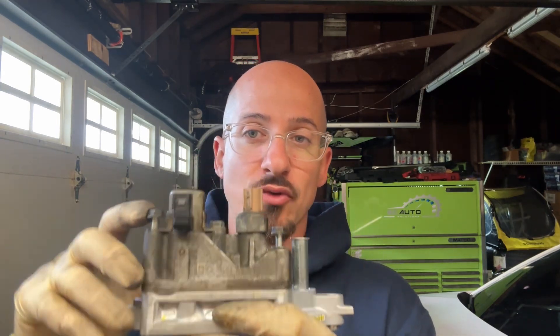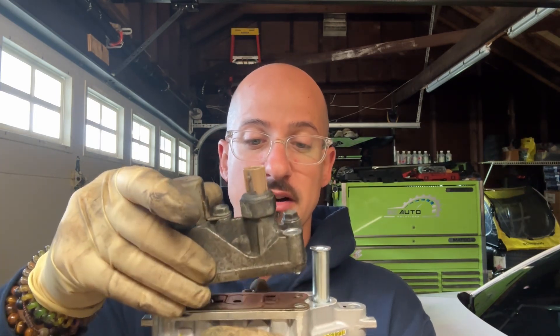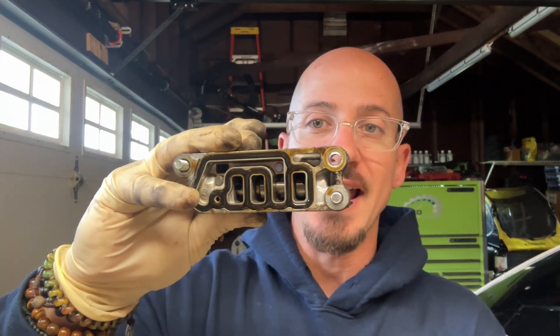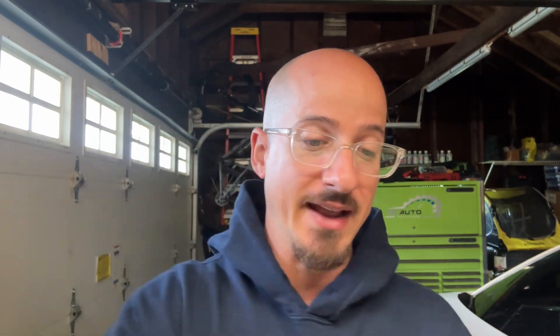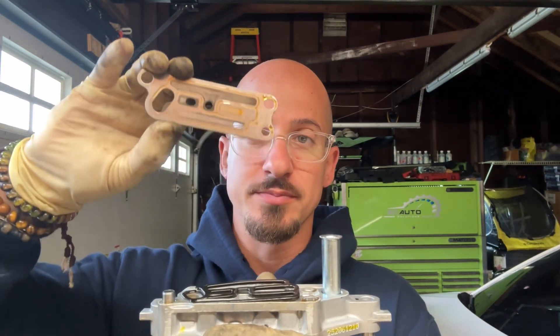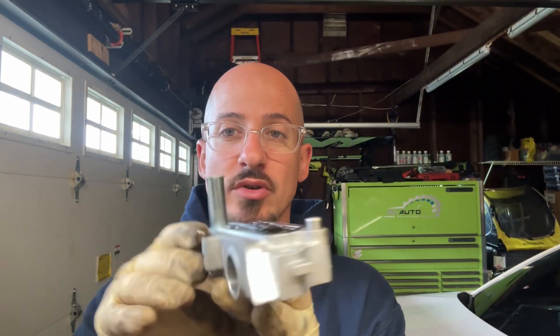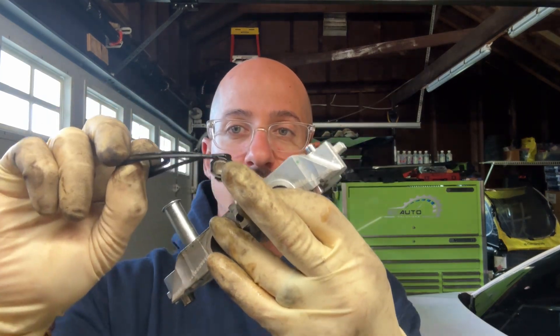Typically the customer goes for the less labor-intensive option — you get the new solenoid with the two new gaskets. You have three T10s right here; I have a full video linked in the description. You split it apart like this and there's one gasket here, which usually comes with the new valve. There are two dowel pins — one here and one on the other end — and then you have this plate, which can only go on one way. There's also a second gasket, and this one is a perfect example because it's split right here.